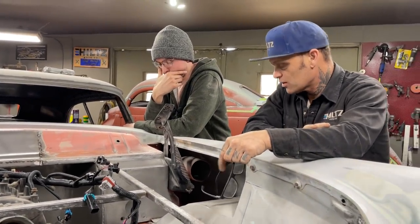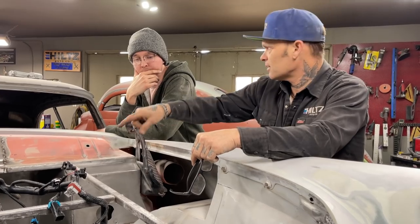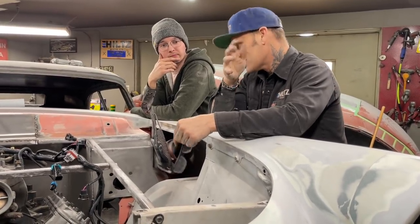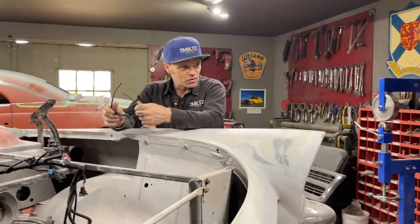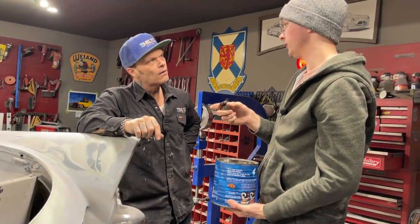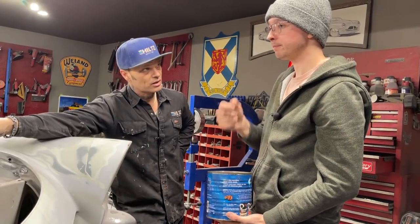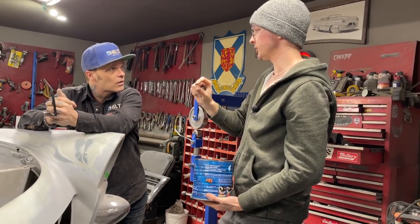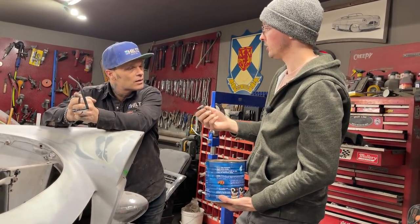I think I'll just use the truck gas pedal — it makes it easier. When I make cars I generally make everything: the gas pedal, suspension, hood latch, windows. The bracket on the throttle cable for a truck is a square clip connector that goes through a square hole in the firewall. There's a little clip on the plastic sheathing at the end of the throttle cable to hold it in place. I've used a chassis punch like this in the past — you just tighten a bolt and it shears a clean square hole.